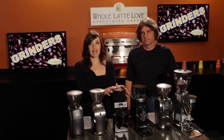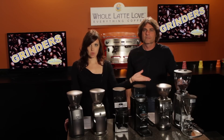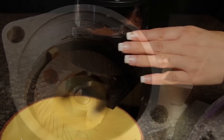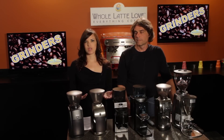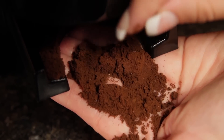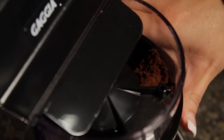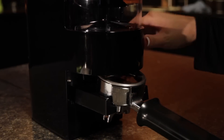Our next mid-grade model is the Gaggia MDF. The grinders we've looked at so far use conical burrs, but the MDF and the other models we'll be taking a look at use flat burrs. Flat burrs tend to produce a more consistent particle size than conical burrs, and particle size is very important in espresso brewing. That's also important when you're making pressed coffee or if you brew with other methods which employ permanent metal filters — for those, a more consistent grind means fewer fines in your cup. The MDF has 34 stepped grind settings. It comes only as a doser model, which means you grind into a hopper and then pull a lever on the side to dose a portafilter, so it's really set up mainly for espresso brewing with the doser and the permanent portafilter bracket. However, it is capable of grinding for all brew methods.